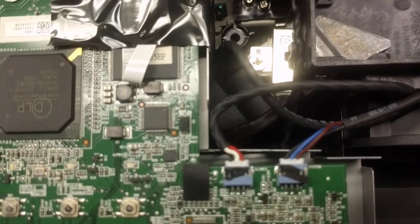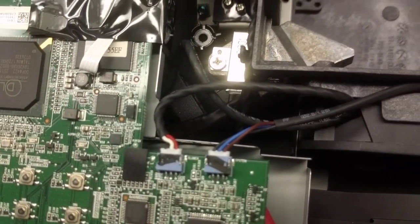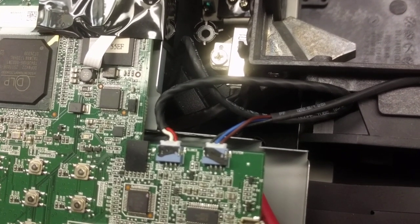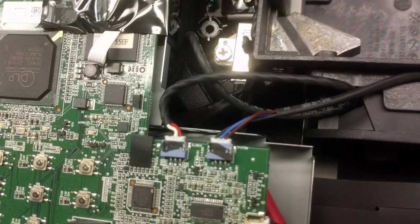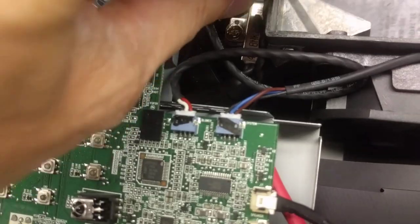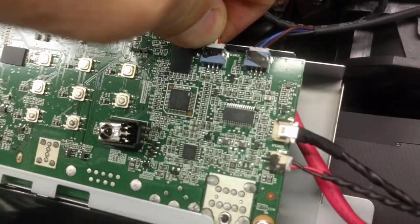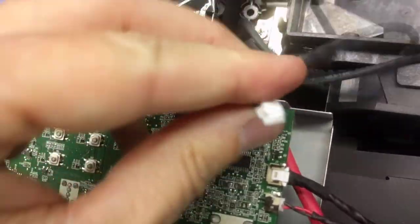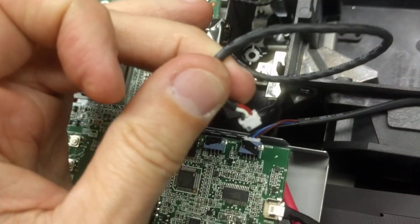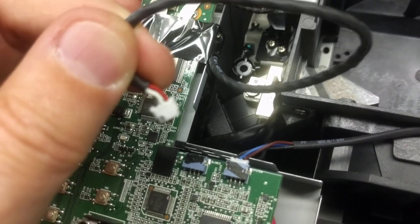And if you look up close, and this is the best I'm going to be able to do on this device that I'm doing the quick video with, you'll see that the wires on the blower are bigger in diameter, at least the insulation is. And when I actually went in and took a look at that harness, and I'll undo it here, those wires, when you put a wire that's too big for the contact that you use and too big for the connector, you maybe can't appreciate it here.